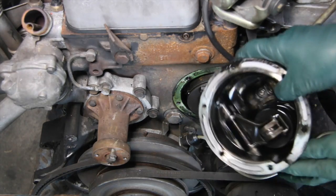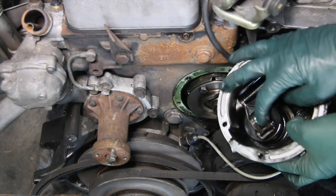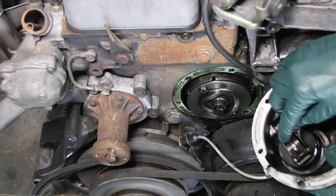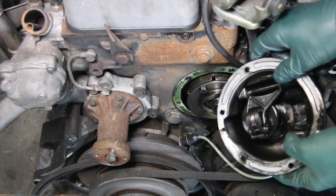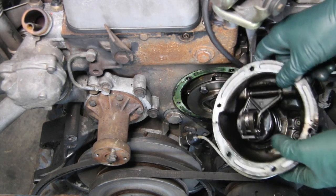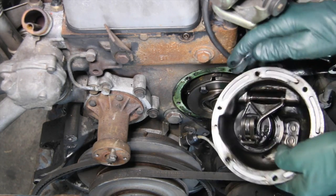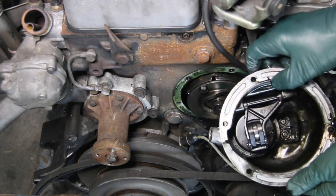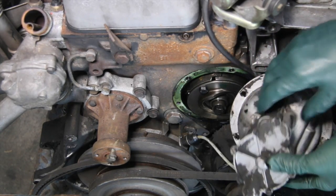The other thing to immediately check is the ball bearing right here. This ball bearing can disintegrate and the cam will start riding on the bracket, which really makes a lot of noise. Also check for a broken spring down in here — this should not be loose. If it's loose, your springs are weak or broken.